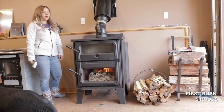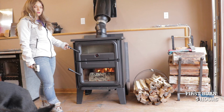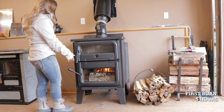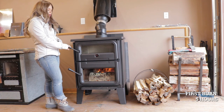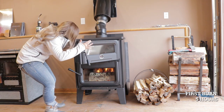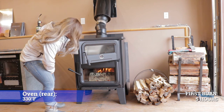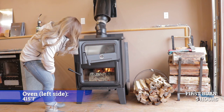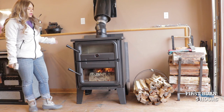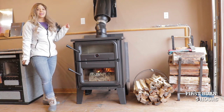I'm going to give you guys some oven temperature readings right now. We are about four to four and a half hours into this. I'm in a medium burn, so I'm not at the maximum temperature. When you do your first burn, you just bring up the stove slowly, so we're not going to be at the maximum oven temperature right now. On this side of the oven we're reading about 415 degrees. The rear of the oven is 330 degrees. The left-hand side is 415 degrees. Bottom of the oven is reading 425 degrees. Nice hot oven temperatures, even with just a kindling fire into a medium burn. You can easily get this oven up to baking temperature without having to get the stove roaring hot.